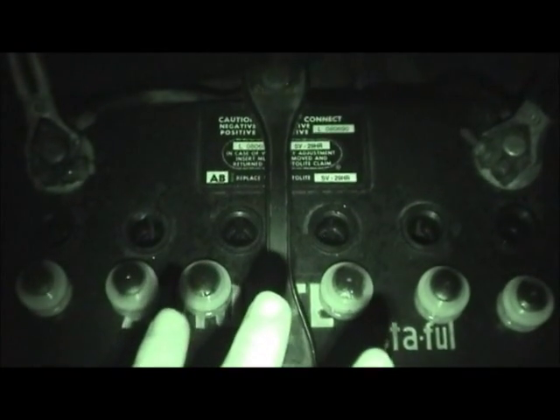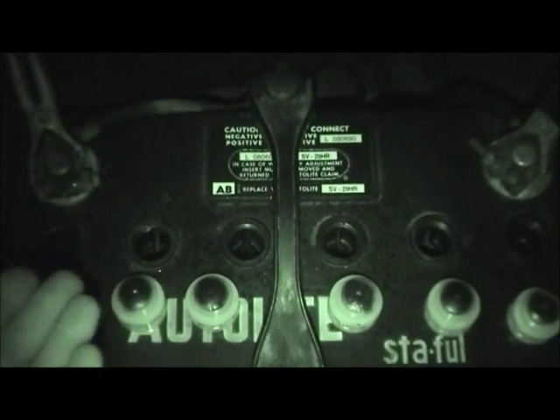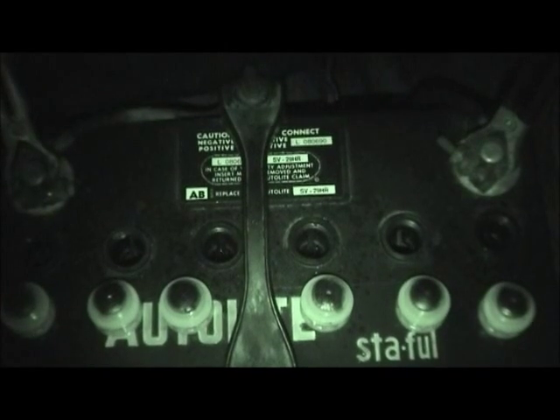I don't think I'll go back in with the same kind of battery — the reproduction type. The reason is that valve-regulated lead-acid or absorbed glass mat batteries are very, very sensitive to being overcharged. You can't really go beyond about 14.8 to 15 volts before the battery starts to gas and those special vent valves pop, the battery loses electrolyte, and there's no way to replenish the electrolyte like you can on this battery, where you just add distilled water.